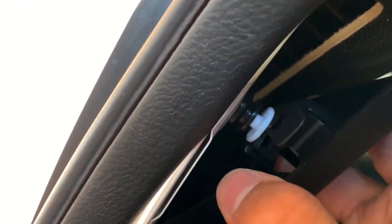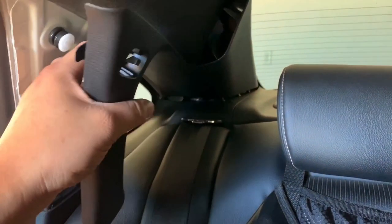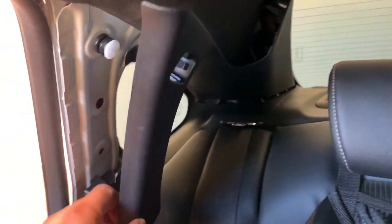After a little bit of digging, it looks like the best way to go about this — so that you're not really needing to remove the headliner — is to actually remove the plastic pieces. You can actually remove this little airbag piece right here that says SRS airbag on it. This pops off. What I did just to give us a little more room is push the plastic up so I could slide it up the clip and get a better look.